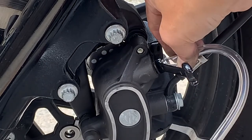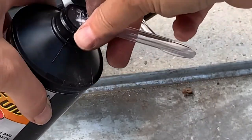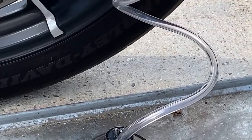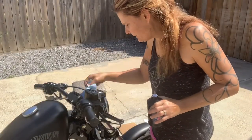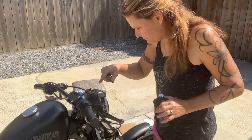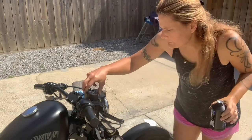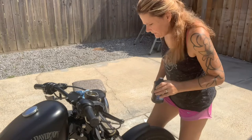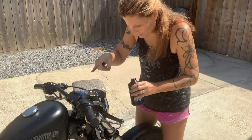I'll use an empty container to catch the fluid. When bleeding your brakes, always make sure you have a few paper towels handy just in case any brake fluid leaks on anything — and a piece of cardboard to put the brake reservoir cap on. I like to crack open the bleeder valve first before I get started so I don't have to fight with it in the middle of bleeding. They sell bleeding kits you can use by yourself, but because I'm right here on a motorcycle, it's just as easy to do it by hand.